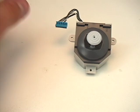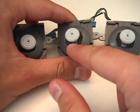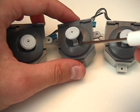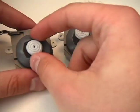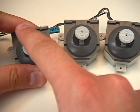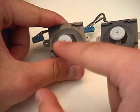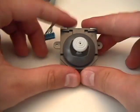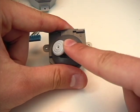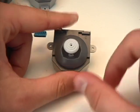Just to show you guys - compared to the analog stick in totally unfixed condition and then semi-fixed condition. The unfixed one falls down, it's totally loose - horrible, the only direction that works halfway decent is back. Here we have the semi-fixed joystick - it's already a lot better, but still pretty loose. It doesn't fall down, but it's not great. And then here's the fixed one. You can see there is almost no looseness at all - it is really tight. Take it right, left, down, up - it's just nice and solid any way you take it. That's it, it's really tight.